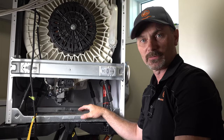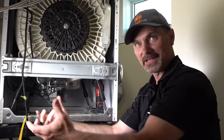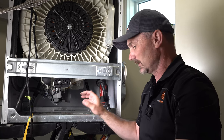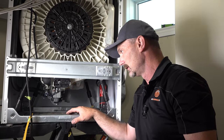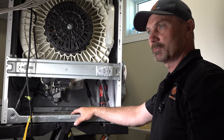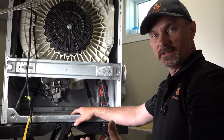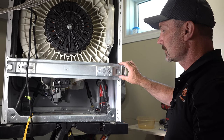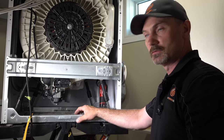As you can see, it really wasn't that difficult to do myself. Being up on this table was maybe a little better than laying on my belly trying to see what I was doing, but you could still do this easily with the washer sitting on the floor — maybe on one of those stands with the drawer underneath. Pretty quick job. If I wasn't doing this video, it maybe would have taken me half an hour by the time I rounded up all the tools. There wasn't very much I needed: basically a socket to take the screws off the back, a different size socket for the pump, a pair of pliers, and a bowl. Simple.